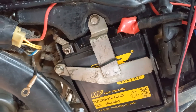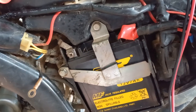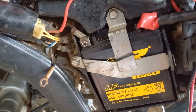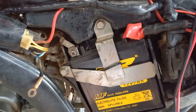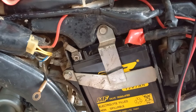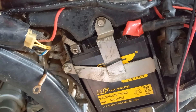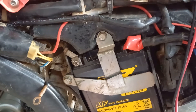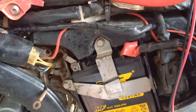Anyway, we broke down again two weeks ago. I suddenly didn't have any battery power and the bike wouldn't start. I had to bump start it a few times, and then I thought, 'Oh wait, I know what this is — the terminals are gone again.' So I cleaned the terminals and sure enough it charged the battery back up in no time. But yesterday it started playing up again, so I cleaned the terminals again and it kind of charged up, but it's not really topping the battery right up.